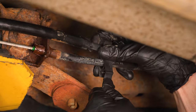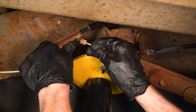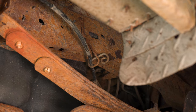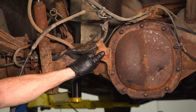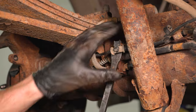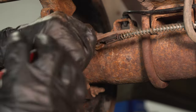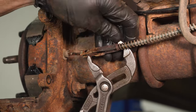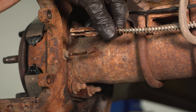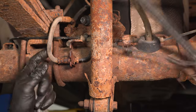Go ahead and separate the cables from each other, assuming they are attached in some way. You're going to find that the cable makes its way through several brackets — some you'll slide through, others are held in place, maybe along the differential. When removing and replacing the cables, always pay special attention to your ABS wires. If one is in the way, just go ahead and dislodge it. Once you get to the far end, disconnect it from whatever it's holding onto, whether it's another cable or the pivot along the backside. The emergency brake cable is now freed up and can be removed completely.